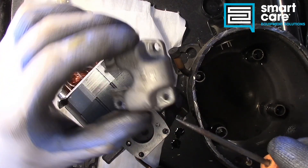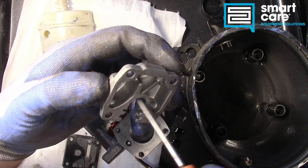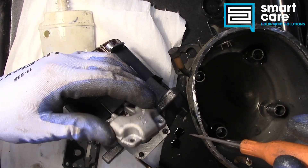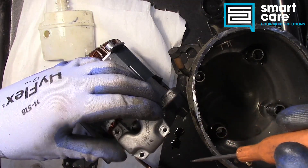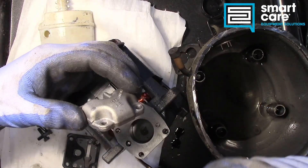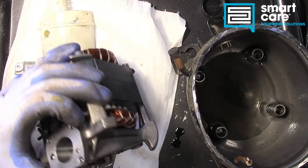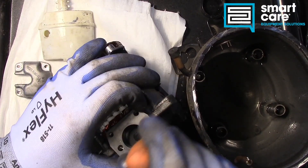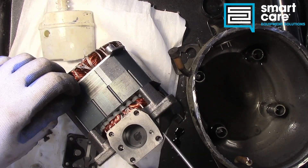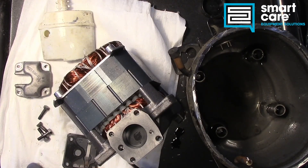When we looked at our valve cover, the outlet area is this space and the inlet space was this area. Our outlet space lines up on top of two ports. So this would be one of our outlets, and it looks like our other outlet was piloted but they didn't drill it — so it would have been possible to machine this differently to have the outlet on the other side. Our vapor outlet drops down through and goes through our tubing assembly here.